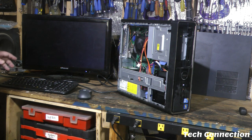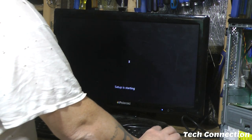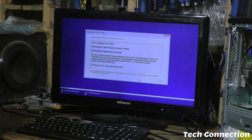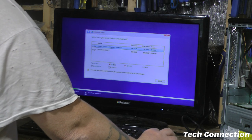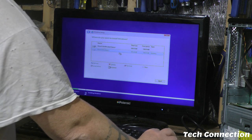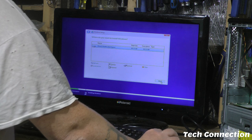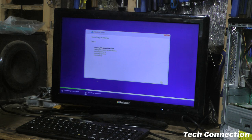You have to press F12 — you have to be pretty quick. This one is the next. Install now. We're going to delete partition 1 and partition 2 system reserve, then go to drive 0 partition 1 and delete. We're going to click next and now it's going to go ahead and start installing Windows 11. I just took out my disk.